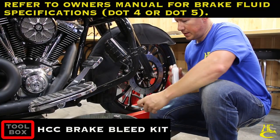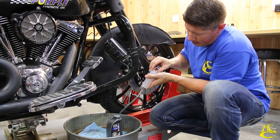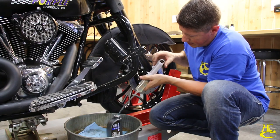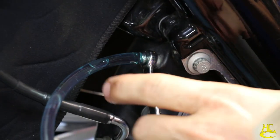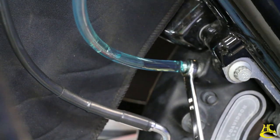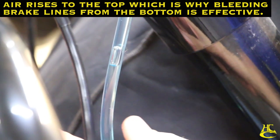So we've got our syringe and brake fluid — we'll stick that in there and just draw it out. You don't have to get it all the way full, but let's get some fluid in there. Take this out, we're going to stick that right there on the bleeder screw. Try not to make a mess, especially if it's DOT 4. See, I've got a little air bubble right there — we want to get that out, we don't want that in the system. Just tap it and let it go ahead and get out of our system.